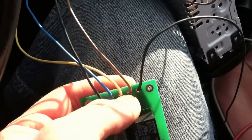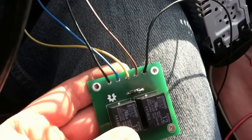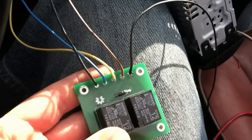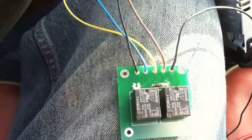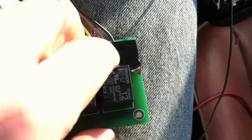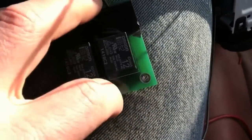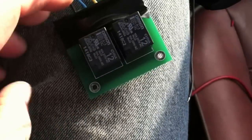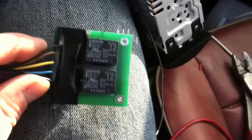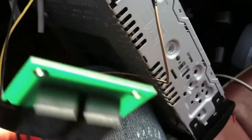We've got a couple of solder pads here that are exposed for all these wires, and a diode that's kind of exposed. So we're going to wrap this into the relay pack with electrical tape just to keep it safe. Everything inside my dash is plastic so I'd probably be okay, but just to give you a proper procedure — we've got a loop of electrical tape on here so nothing will short, and padding on the back to keep the relay contacts from shorting. We've still got these two nice holes and if you need all four they're still under the electrical tape. You can even put this in a project box, but I was trying to keep the price down. If you have somewhere in your car you'd like to zip tie this, that'll keep it from rattling around.